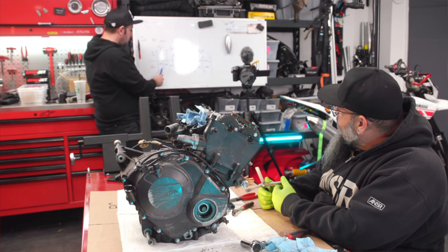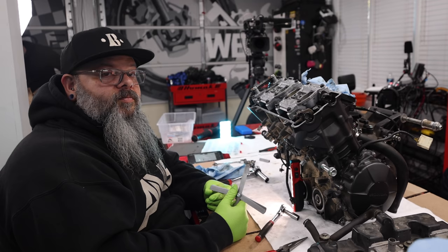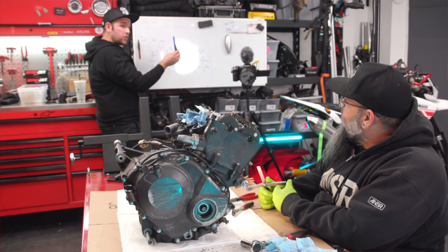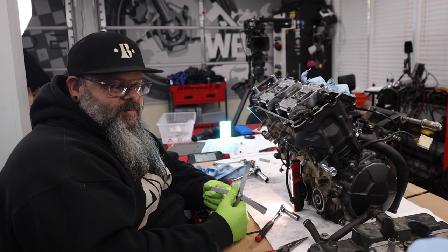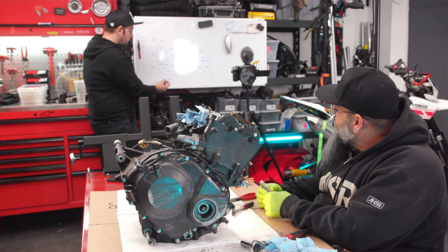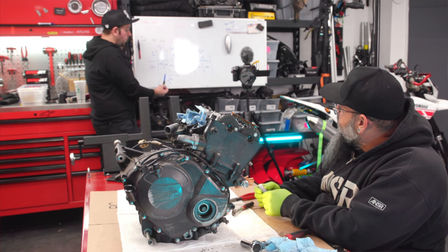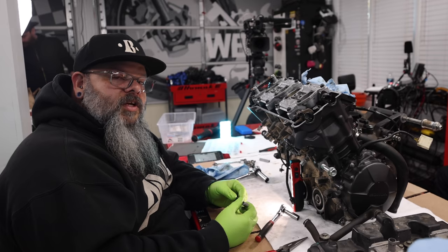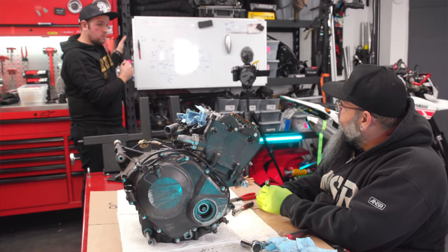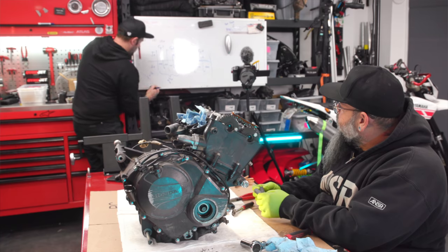Are we able to get these to 0.011? We can get them to between 0.010 and 0.012. And that's by upping the shims, or lowering the shims? Making the shims smaller, making the space bigger. So if we change these to different shims, then we get all of our 195s back, and we could potentially use them elsewhere. So if I change those 195s to 190s, but yeah, it may be too big at that point. So that's what we're wondering.